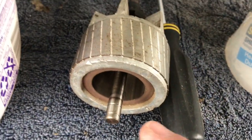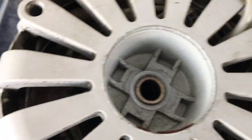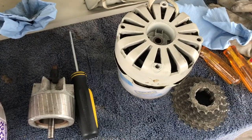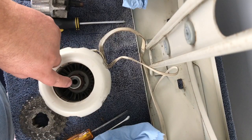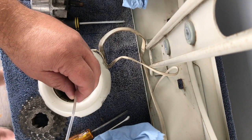And then I'm going to oil the shaft too, make sure it's got real good coverage so that when we slide it together, everything's smooth and we don't damage any of our bearing surfaces. That's all you got to know. On this one, we want to get also the felt that's in the front. So we're going to oil pretty liberally here in the front.